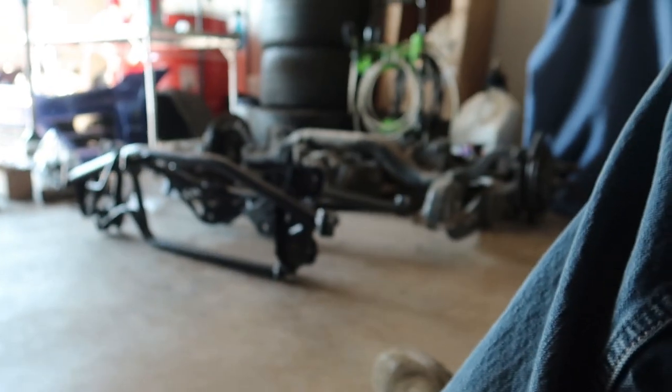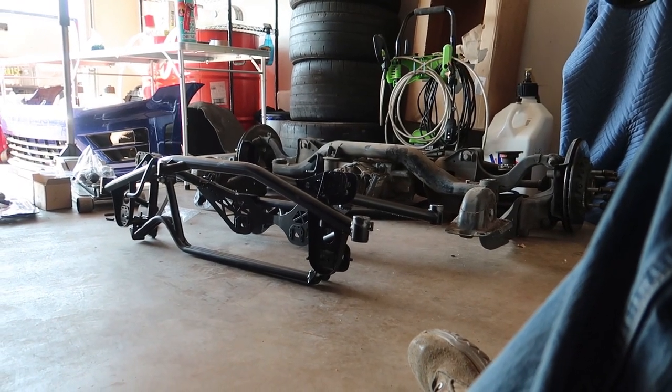Alright guys, so this is not gonna go as I planned. Glad I read the instructions first. Basically what the instructions say is when you go to install the subframe, the only thing installed on it is some clips for the brake lines, which they include — some plastic clips that screw into some nubs. The only thing that's going to be on the subframe is the differential. You install the differential into the subframe, then you put the subframe up, align it, put the bolts in all the way, then lower it a couple millimeters.